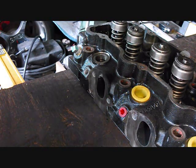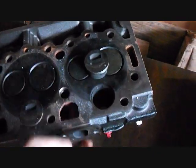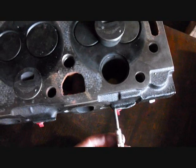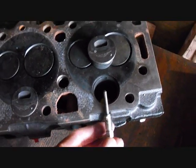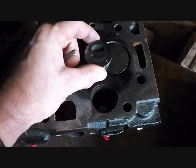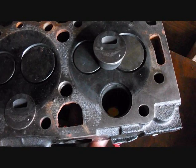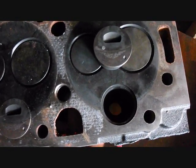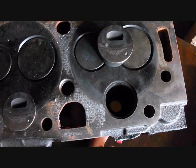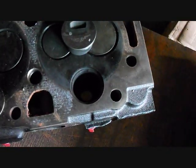That's about it. Oh, just in case you're interested, since I got this out here, this is what the other side looks like. This is where the glow plug comes through, obviously this head is upside down, but the glow plug goes in there, and it would go into the pre-chamber like that. This is your pre-cup, and it goes down there like that. But on the other side, I think you can see right there where the hole is, that's where the injector itself would go. And so you would pull that out, and then you can clean any debris out of the pre-chamber right there.